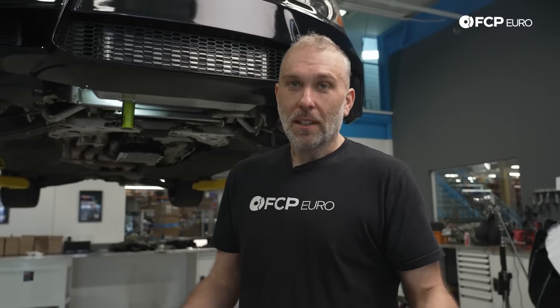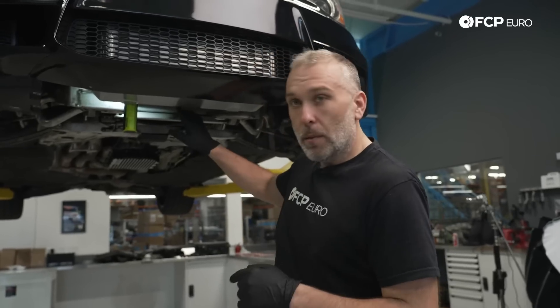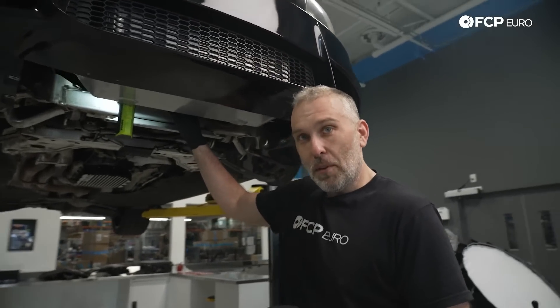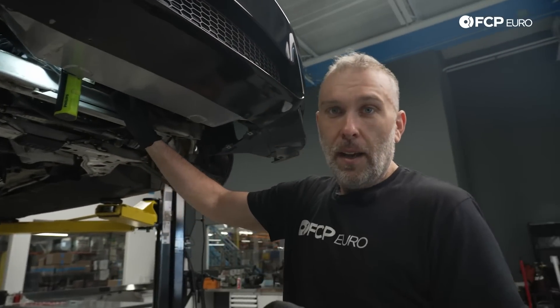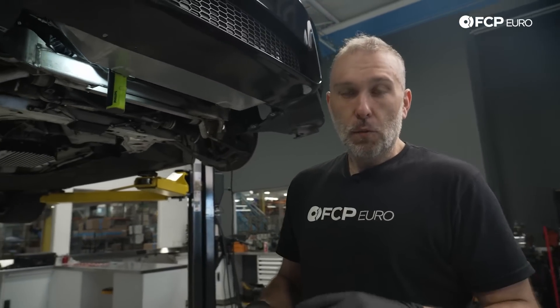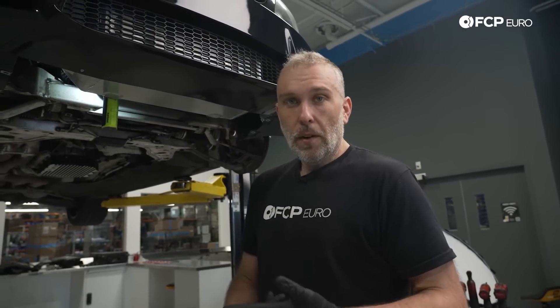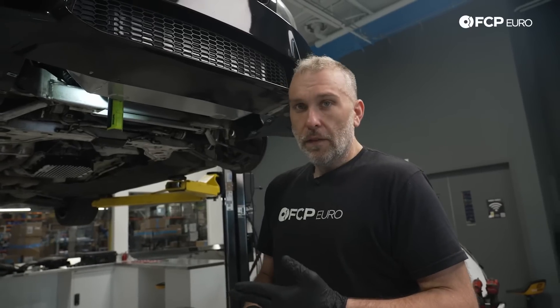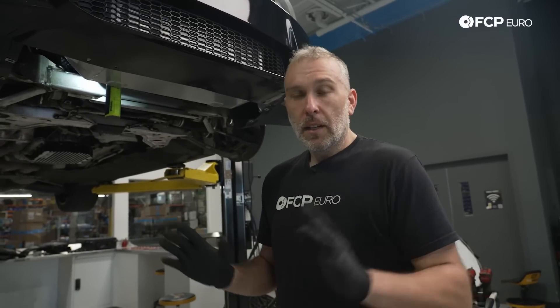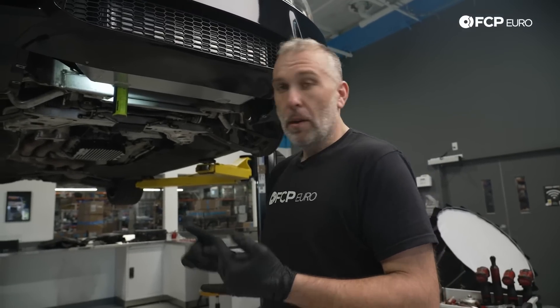But is the water pump actually missing? The answer is no — it's there. The problem is your DME doesn't know it's there. The reason for that is the aluminum screw that holds the water pump ground to the bed plate in the engine block has mysteriously broken off. This only seems to be an issue on N55s, because this water pump ground is used for N52s and N54s, but it seems to affect N55s only. Could be a material problem with the screw, could be a harmonics problem, or maybe they weren't torqued properly from the factory and the screw loosens up over time.